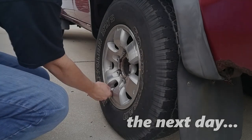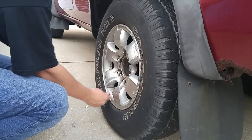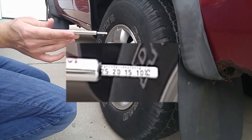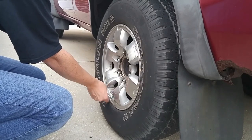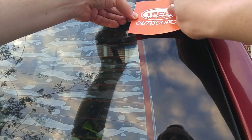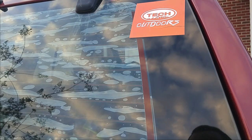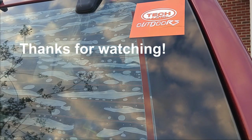The next day I went ahead and grabbed my tire pressure gauge, went out to the tire I had plugged after letting it sit overnight, and checked the pressure. You can see it here — 26 PSI, exactly the same amount of air I put in it the night before when I aired it up, meaning the plug install was successful. So I'm done with that — that swag sticker has earned its place on my back windshield. Anyhow, that's all I've got, so thanks for watching and I hope to catch you next time on another episode of Hobbies Hobbies.